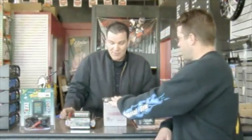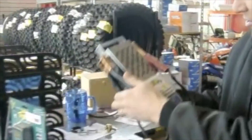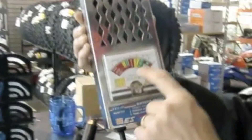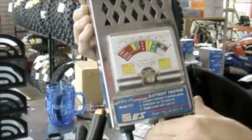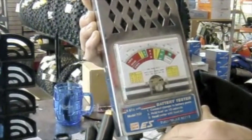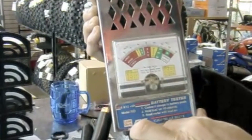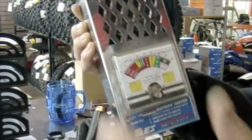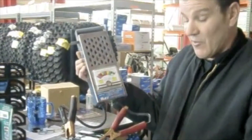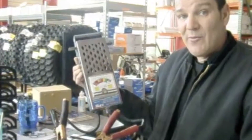To find out the state of a battery, here's how you use a battery load tester. You connect negative to negative, positive to positive, and it gives you a readout. This one is reading 12 volts. When you pull the trigger, it puts a load on the battery — you can see it dropping toward bad. Once released, it still shows some charge. Before replacing it, I'd give it a three to four hour, one-and-a-half amp trickle charge, then load test it again. If it stays in the green, it should be good enough to run on the motorcycle.